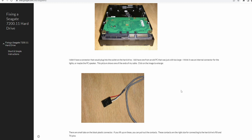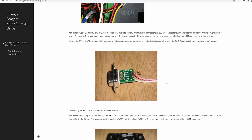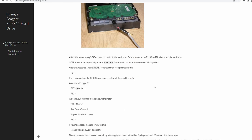This video is about how to reset and recover data from my 500GB Seagate drive. It was a 7200.12 board, not the 7200.11. For the 7200.11 hard drive, you need an additional piece of paper between the board and the head circuit inside the disk — for the .12 board you don't need that. While trying to enter terminal mode by pressing Ctrl+Z, it was showing 'SATA reset' instead, meaning the disk was in BSY mode.